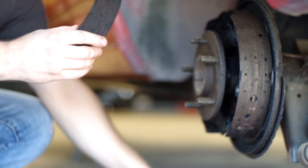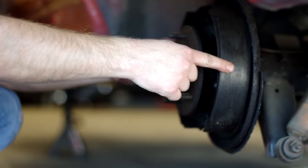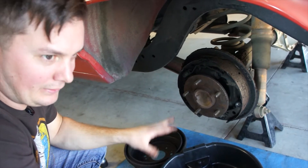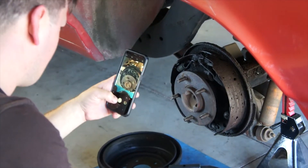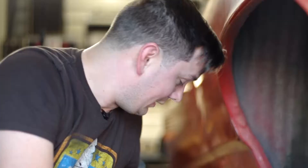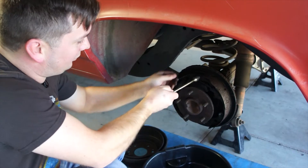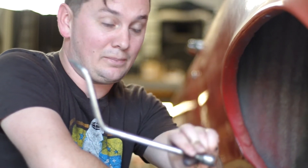This is the brake shoe material. Traditionally it is connected — like that — but ours is broken, so we're going to have to rebuild this. The wheel cylinder is dead anyway. Drum brakes aren't as hard as most people think — a lot of people are intimidated by them, but they're actually not too complicated. The best thing you can do is just take pictures of every single angle. That way if you do forget how they go together, you can look it up. Also, if you do one side at a time, you can go back and look at the other side. A couple of different tools help you. This is a brake tool — I forget what it's called — but it helps you pop off all those little springs. You just rotate them and pop them off. These are essential, you can buy them anywhere, they're pretty cheap.